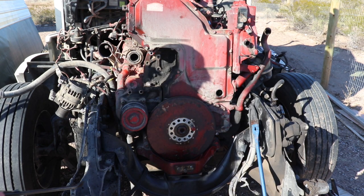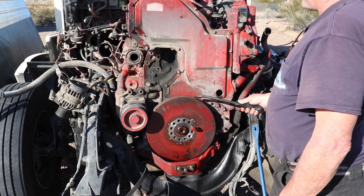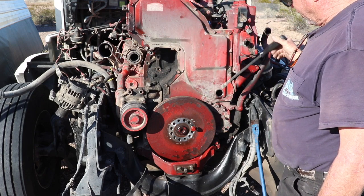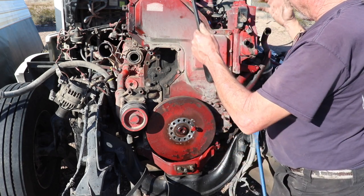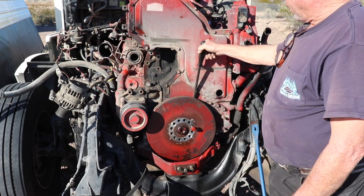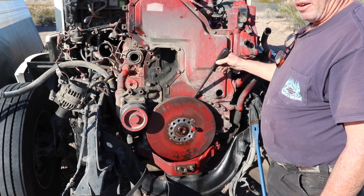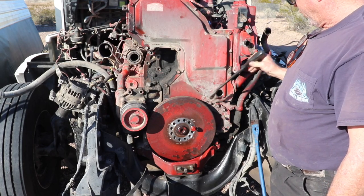So I've been working on this damper for days now and I can't get it off. I don't really need to take it off, but I wanted to because I wanted to make a good seal on the cover when I put it all back together. There are also two bolts behind the flywheel that hold this cover on — they're all slotted — so if you just loosen up the nuts you can take the rest of the bolts off and the cover comes off. The other issue was this bolt here: with a standard 13 the head was rounded off and I couldn't bust it loose. What I ended up doing was hammering down a half-inch on a really tight fit and I was able to get those two nuts loosened up. So the rest should be pretty straightforward in getting this timing cover off.